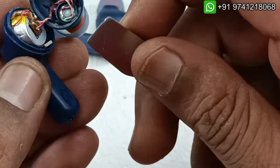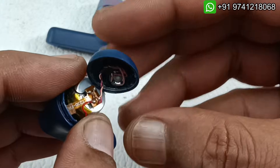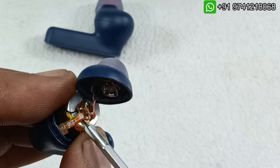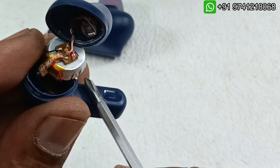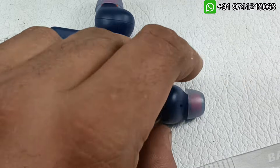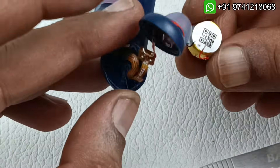This is the internal look. We have to take out the battery, and to do that we need to remove this flex cable very carefully, otherwise you may end up breaking it. There are two leads connected to the battery on this flex cable — the red one is positive and the black one is negative. If you interchange the terminals when replacing the battery, the motherboard of this earbud will die and be of no use. It is clearly written here: B plus and B minus.